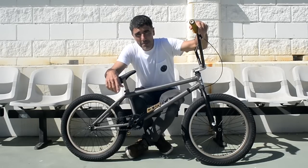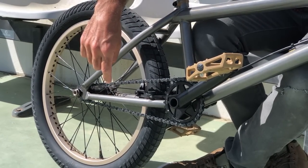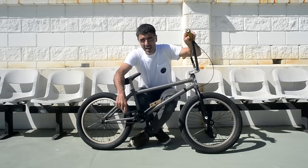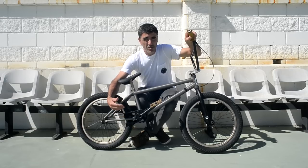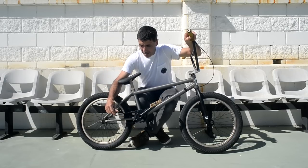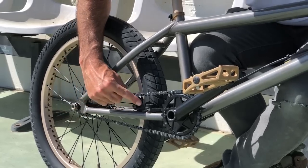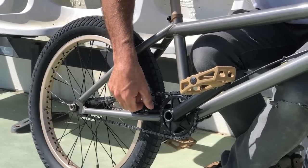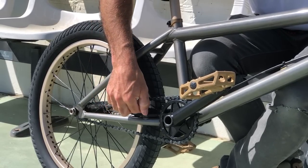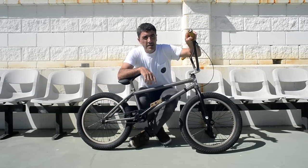Here we have the new Flybikes brakes. We worked on the angle of the cable so it runs a little smoother. A big problem we always have is that the brakes tend to get loose and make noise, so when you jump, it kind of rattles. It's really hard to figure out the tolerance to make that really stable. So we came out with this nylon piece that you can spin really easily to adjust it — it can be kind of loose and you adjust it. It's easy, and you get stiff and quiet.